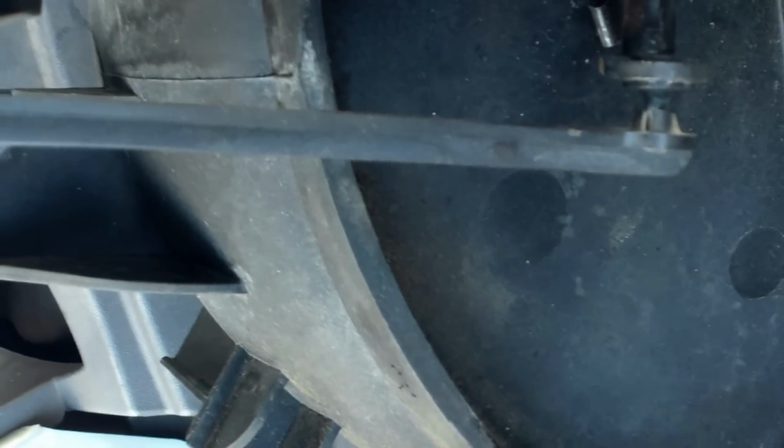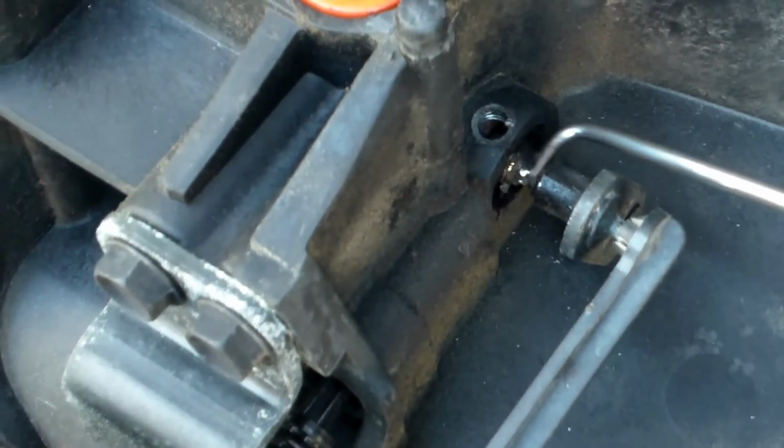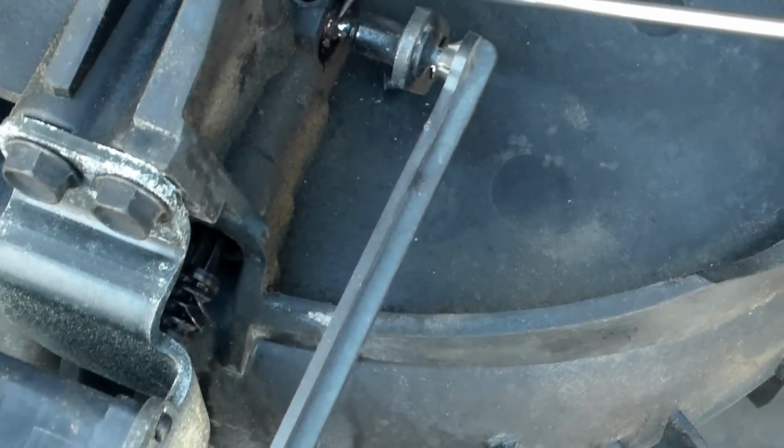And so it should come out about half an inch to three quarters of an inch. What happens when the rod goes in is the bearing sits over here in this gap. So that's why it causes the leaks. Exactly, that gap over here is where the pin should sit to hold the rod in place. That's why you see a little mark right there on that gap, because once the bearing sits here, there's no way it seals air, and that's why you get an air leak in here.